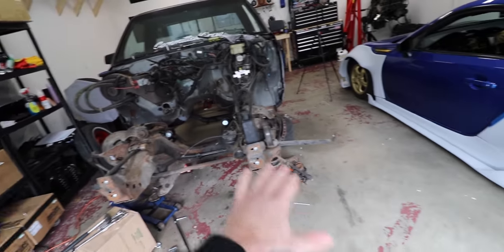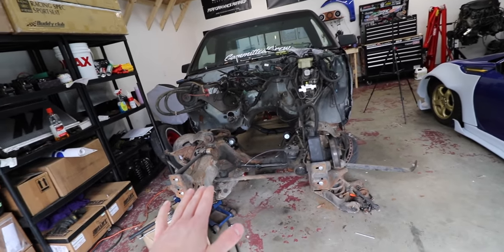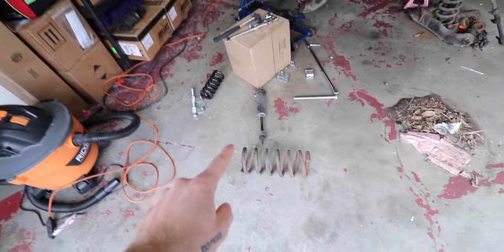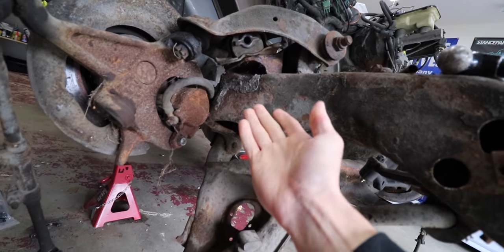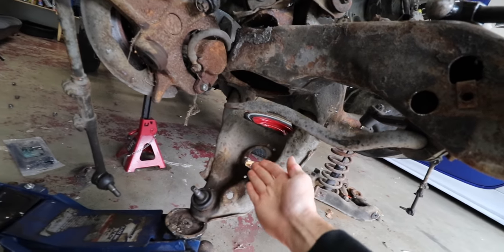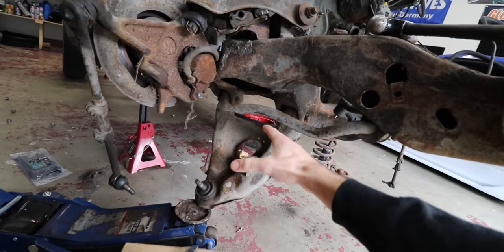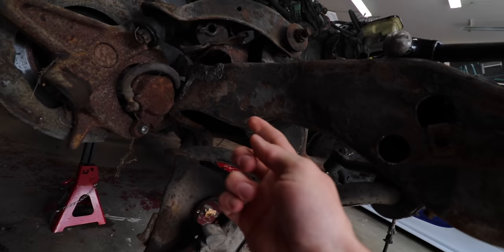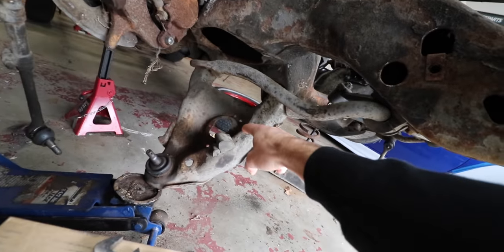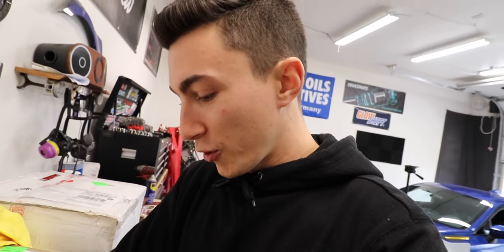Before I left I told you guys I was gonna clean up this whole mess and figure out the truck. But I actually had a huge problem where these springs don't want to compress. The way this sits, it seats up in there, but then this arm has to swing around and it's almost impossible. The only spring compressors I have are outside mounts, and because this thing sits in a huge cup up there, it was literally impossible for me to get that spring on.